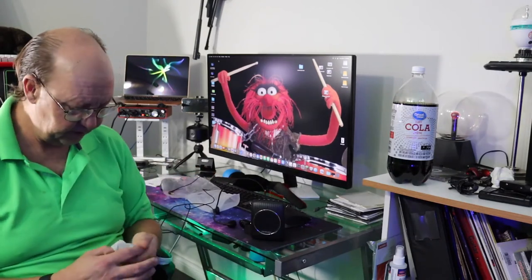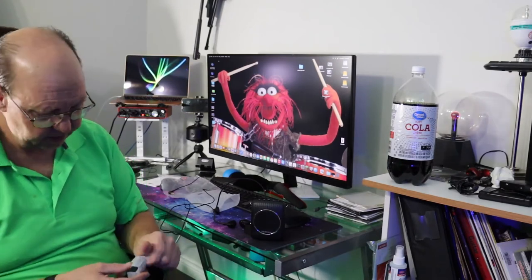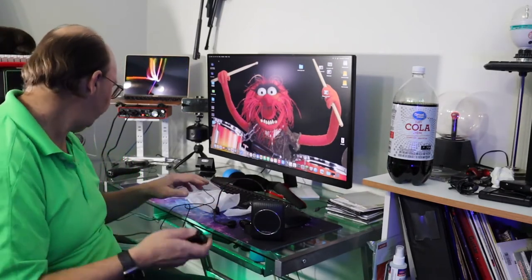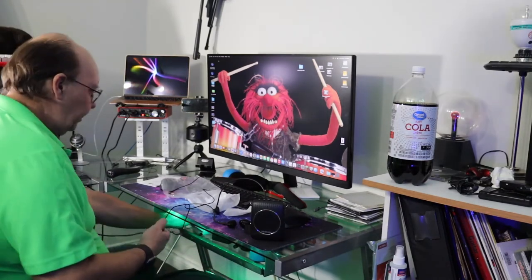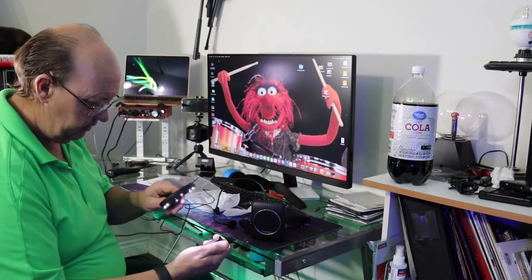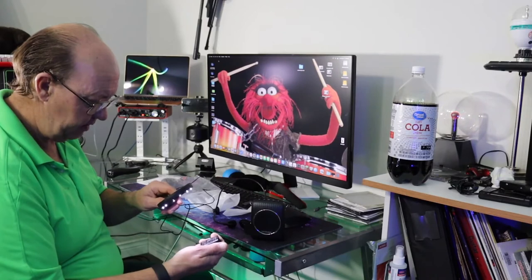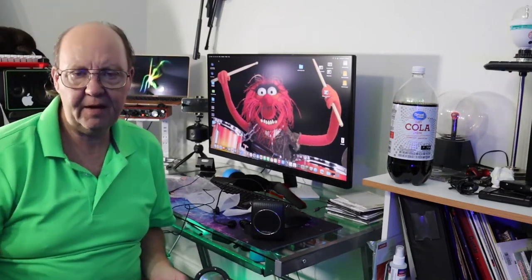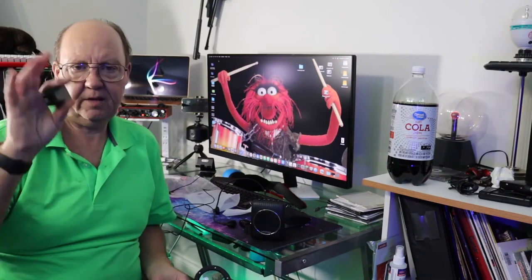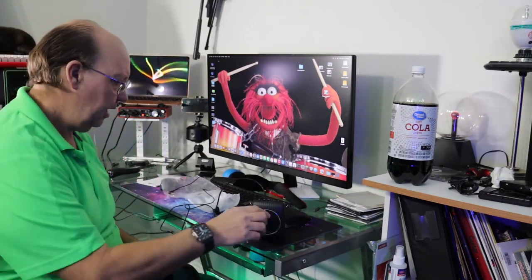As far as the power supply goes, I know someone's gonna want to know, well, we're not stuck with that cable, right? So we could use that cable. What about the power supply? How much power does it actually put out? And to answer that question, I need to get my magnifying glass. So we are sitting at 1 amp, 5 volts, 1 amp. So any USB device that is not gonna require more than 1 amp for charging, then you could use this brick with that cable and charge a USB device. Too simple, right? So that works.